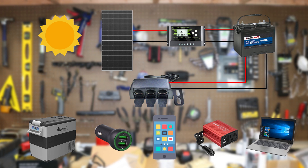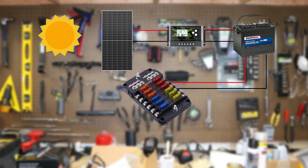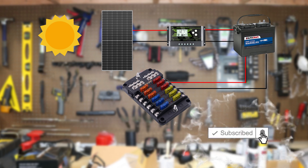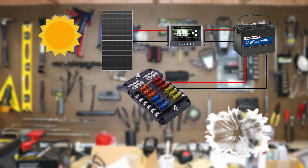If you are planning on wiring up more than three things, I would suggest putting in a fuse box or a relay box to separate all the lines for both safety and convenience. It keeps your electronic devices separate so that if you blow a fuse, all your other connections are still working. I'll show you how to wire a relay box in another video, so make sure you smash that subscribe button if you haven't yet.